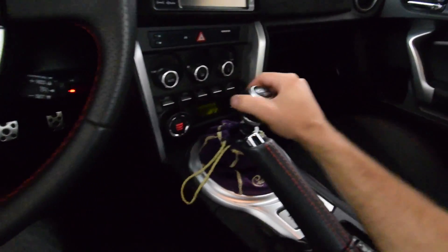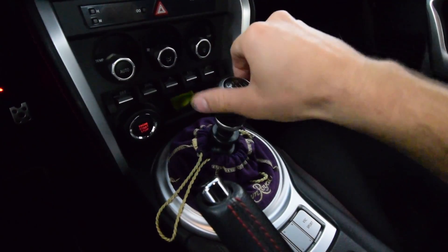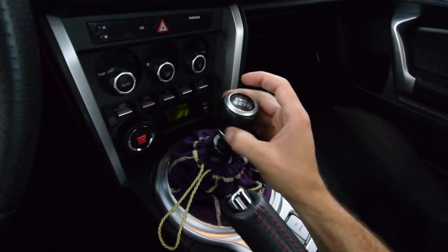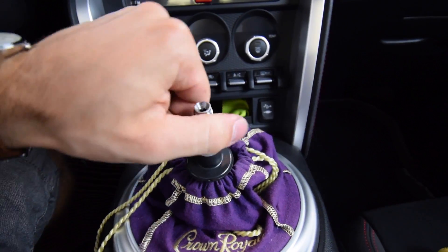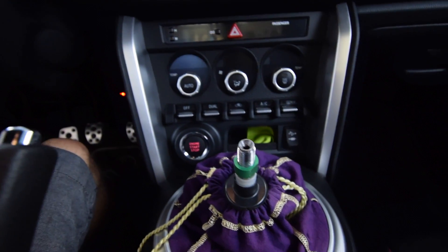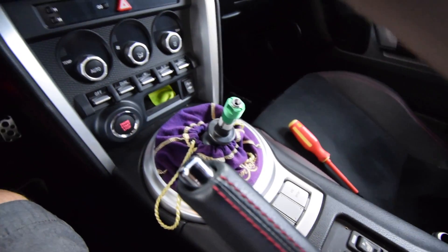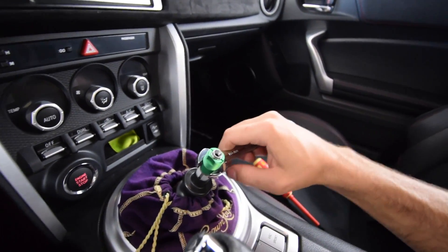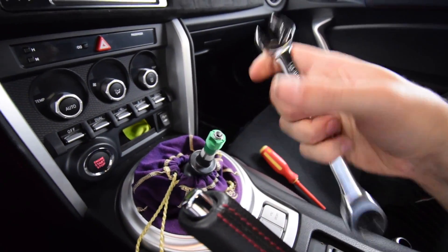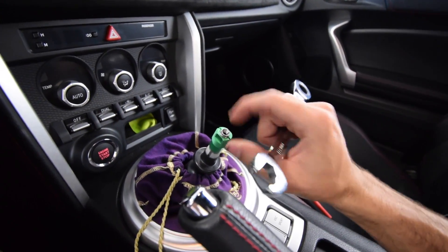Let's start by putting the e-brake up and popping this into neutral. I'm gonna kind of miss this knob — I don't remember if you guys watched when I put the Wish shift knob in here, but I gave that one away so I hope whoever got it is enjoying it. You want to just jam the adapter down at the bottom, then screw the knob on top. I put one wrench here and spun it backwards and another wrench up here and spun it forwards — it jams them together, same idea as coil overs, and then it won't move at all.